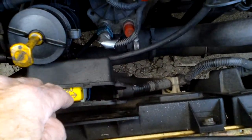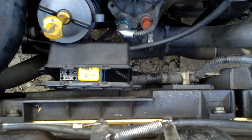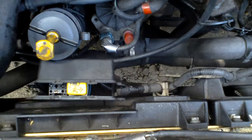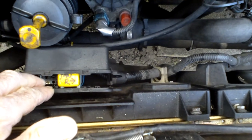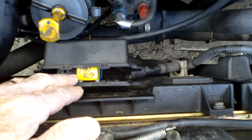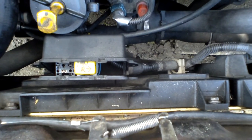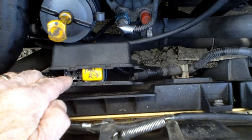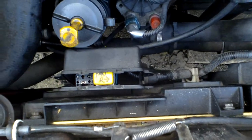This particular fan, the big one on this side - the off side if you like, the one by the dipstick - only comes on when it gets very hot. But as I'm anticipating going up to Scotland, I'd like to kick that in when I hit a big hill. If I hear the other fan come in and it's a long drag, I really want to bypass that relay and have that fan come on as well. My intention is to take the relay side, the earth side, and bring it up and put it into the dash - that will solve the problem.